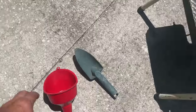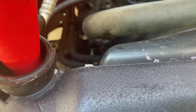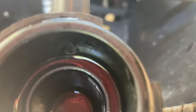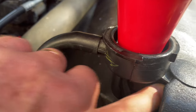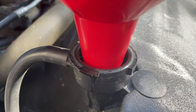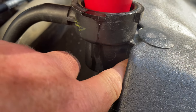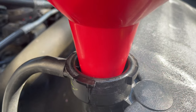I wanted to show you some of the challenges I had. One of the things I had to do was use a good-size funnel that fits inside the neck pretty snug — this one fits tight around the opening. It fits inside the opening tight before it bottoms out on the radiator, so the water comes in and goes that way. You don't want the funnel going all the way down and closing that off. Mine stops about right there, allowing the water to go in while remaining snug and creating a seal around the opening.